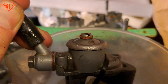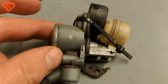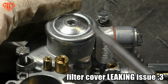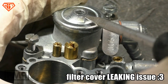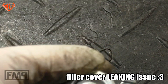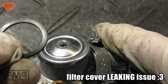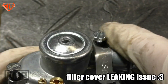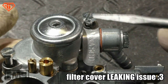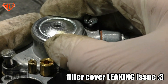So the secret was not the gasket — it was just using a file to shorten that thread. The official dealers and official workshops have no idea about this issue, but it's so obvious. You need to ensure that there is a gap between the lid and the thread. I'll try it without the rubber gasket ring because it is easier to show the problem. The issue is you can see the lid sits on the cover at the chamber.